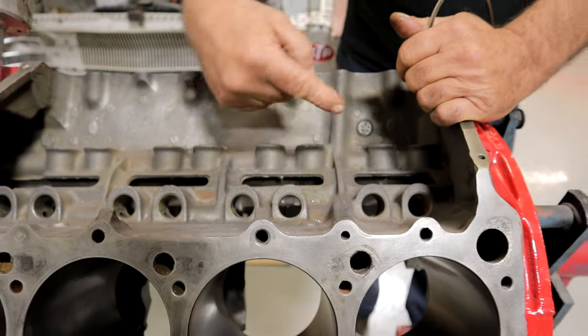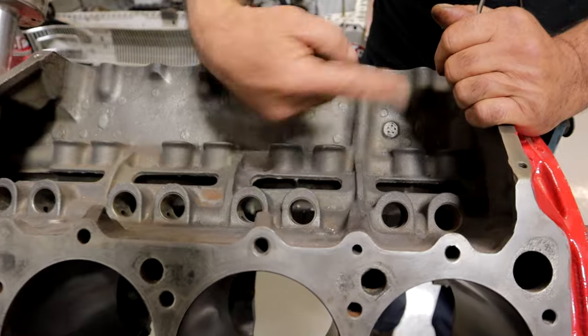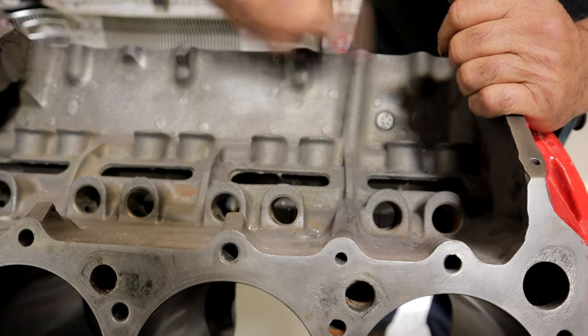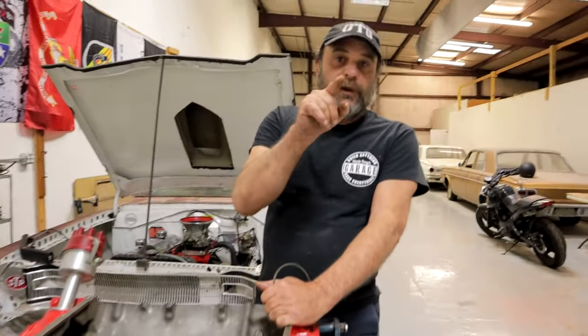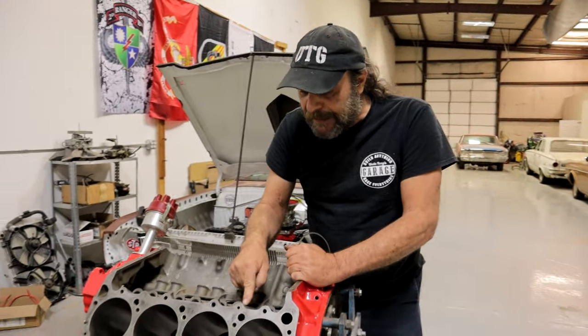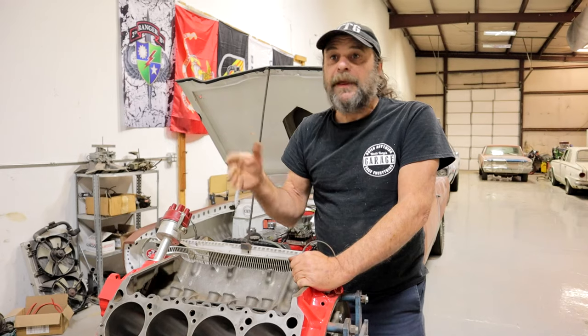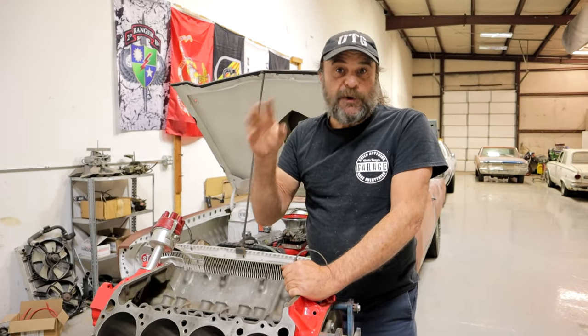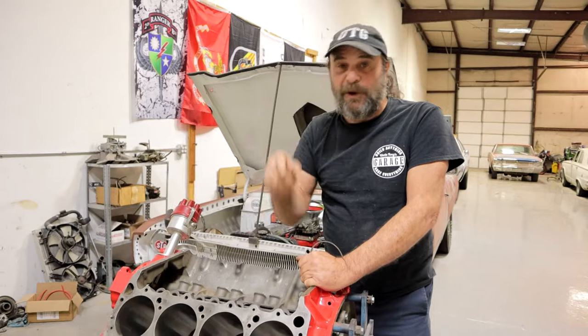As the cam is rotating and the motor's spinning, those holes in the camshaft line up with the bearing passages and deliver a squirt of oil — and that's how these things oil. That camshaft, the way it was, would not have allowed any oil to get up to the rockers. So after probably five or ten minutes of run time, you were going to do damage. You were going to tear up the top end of the motor — there was no oil getting up there through those holes.